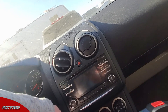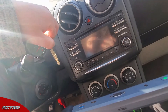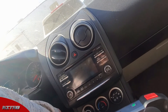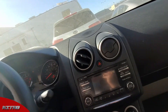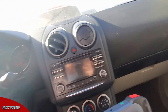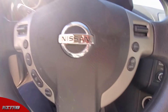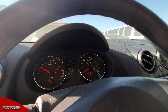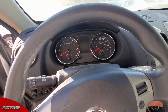If there was another key I would put it in, switch ignition on — the car light would flash five more times and that one would be done. To close programming mode I'm going to switch it back on with the same key — you see that car light flash five times — switch it off and hit okay. Now this emergency key should be programmed, so I should be able to crank the car with this key. Car starts right up.